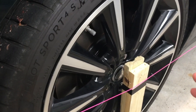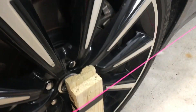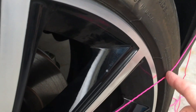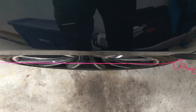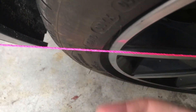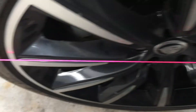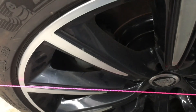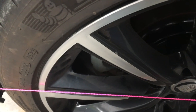We can determine whether the wheels are pointing straight by looking at the gaps — not against the chassis, but actually in the rear. The string goes around the corner, touches the fender, and then touches the tire lip. Looking from above, we can see if this is toe-in or toe-out. The gap here at the front shows the string is barely touching the rubber — about a millimeter off. So this rear wheel is pointing inward by about one millimeter relative to this string, which is parallel between the two axle ends, indicating the thrust angle on this wheel is slightly inward — appropriate for the Jaguar F-Type specification.